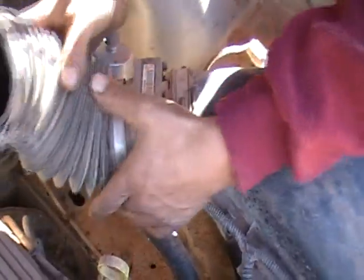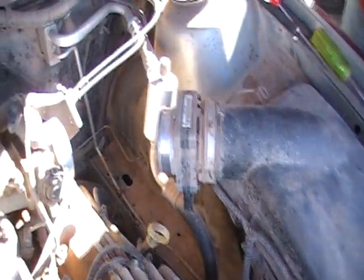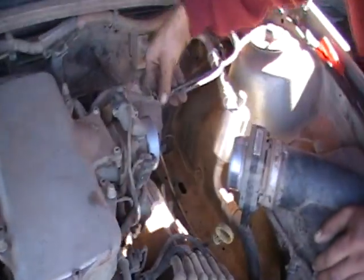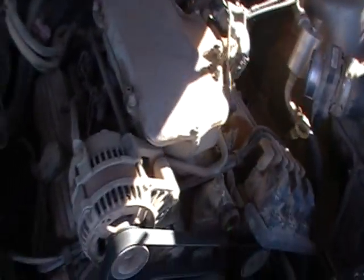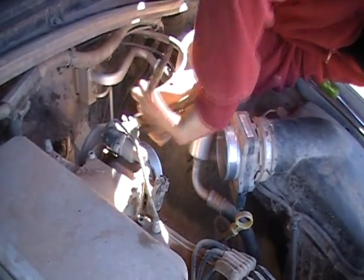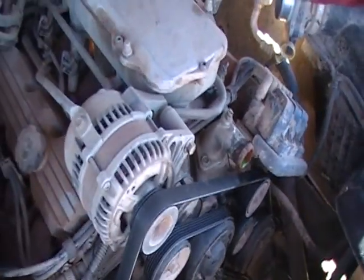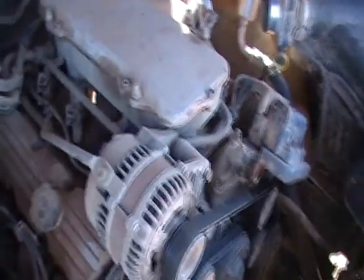After you've dropped the coolant, just pull your air box apart. Take off the air intake and tape. Probably not doing this in the right order, but you get that on the big jobs. It's just a matter of pulling everything off the motor — take your accelerator cable and cruise control off. It's a long process.